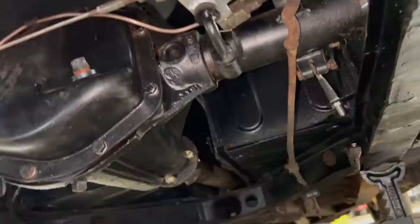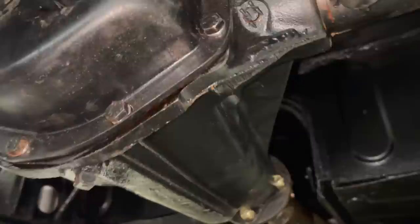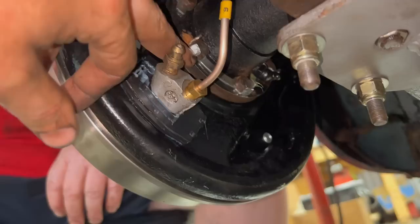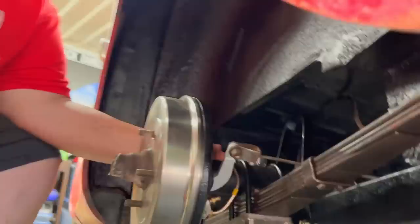Anyway, the brakes are assembled, everything. The springs. Looks great here. So the only thing we need to do is the lock tabs for the top. Yeah, we bend. So we bent these on the bottom, but now we're going to go and bend the ones on top. And then the only thing we have to worry about is the spring, the lever shock attachments, because we're trying to figure out whether that one leaks or not over there. This one seems to be dry.